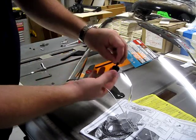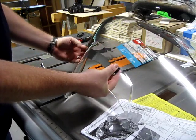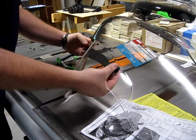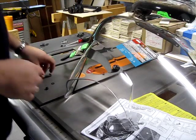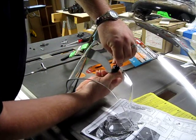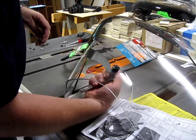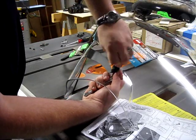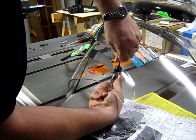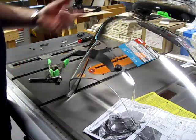Then take your bolt, slide it into the center of the plastic plug, and take the bracket and slide that up. This is going to be kind of tough with one hand, so I'm going to use a spring clamp to make life a little easier — that way everything can just set in place temporarily. Then take your nut and washer, lay it on the other side of the bolt, and tighten it up. I shortened my socket wrench — the other one was a little too big for this application. Still ten millimeter, but this fits better. Just swing it around until it tightens — not too tight, just hand tight. Repeat the process for the other side.